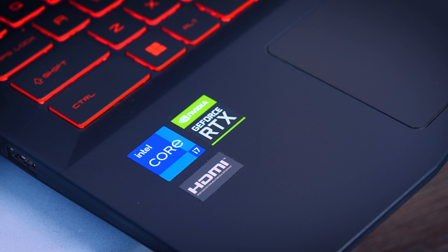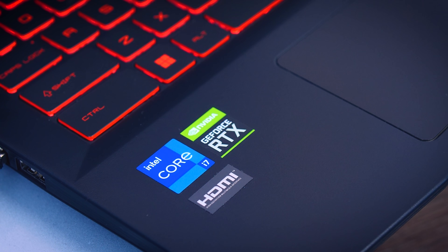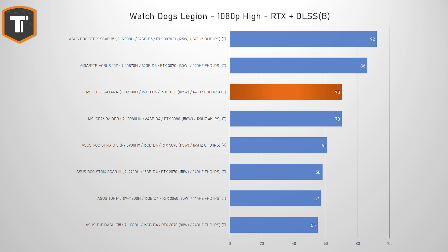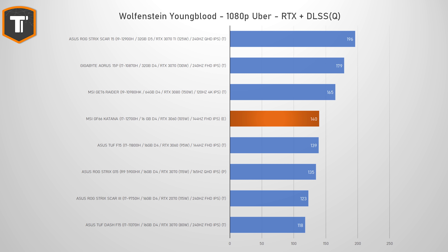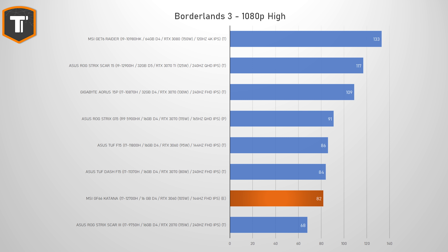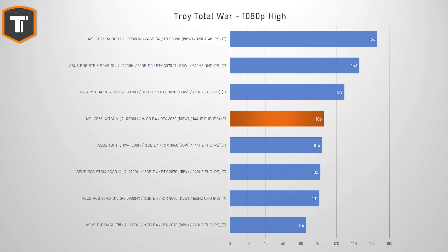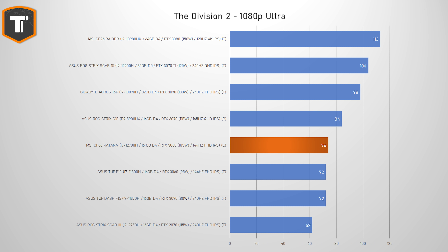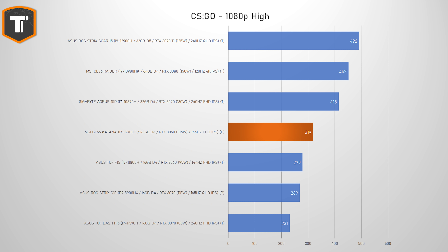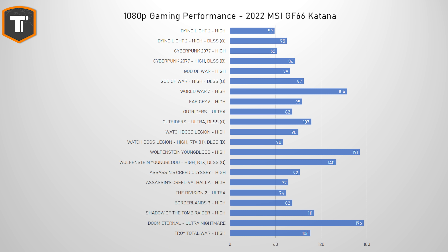Most games rely on the GPU more than the CPU, and this laptop comes with a 105-watt RTX 3060, though in reality it mostly runs at 80 to 90 watts and only hits 105 occasionally. I think the 3060 is a great GPU to aim for — a 1650 or 3050 can struggle with recent titles on higher settings, but a 3060 will run any game easily on high or even higher. A few games like Cyberpunk 2077 and Dying Light 2 do push this card to its limits, but you can turn on DLSS and still get really good frame rates. Unfortunately there is no MUX switch, so laptops that do have one will be a little bit faster, especially in games that run at really high FPS.